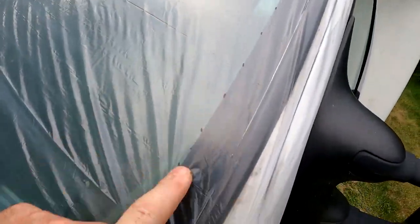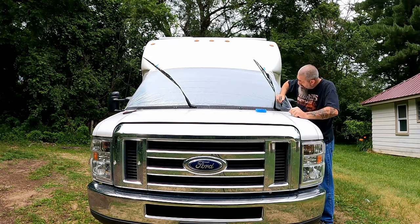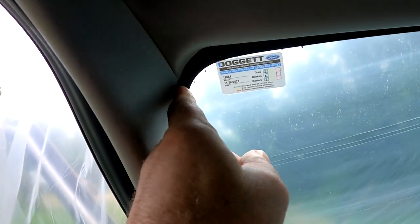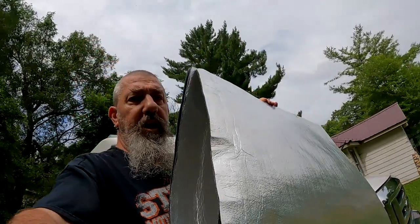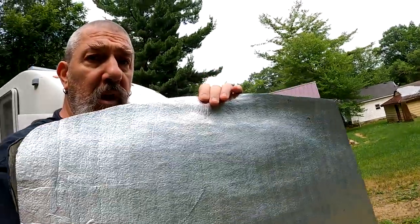I used the black line on the windshield as a guide and dotted all the way around. Now on the inside there is a little bit of a discrepancy, so I need to add a little bit. What I'm going to do is when I trace this plastic out onto the underlayment, I'm going to give it a little bit — about half an inch bigger — and then once I get that cut out I can put it in place and fit and trim it as needed. So I've got the underlayment vapor barrier laid out, the two pieces glued together, and trimmed according to the template. I cut it a little big, so now we're going to dry fit it into the van and see how it fits.